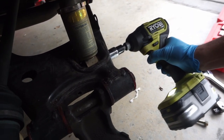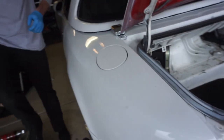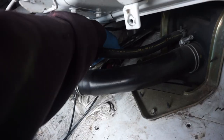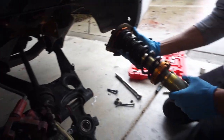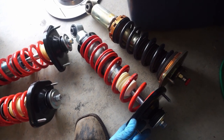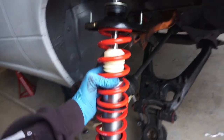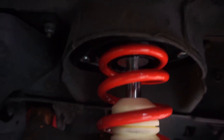Here we're getting some help from the impact gun to remove the coilover — get that bottom bolt out and then we can reach into the trunk to remove the two nuts on the top. It's a bit of a tight squeeze but not the worst thing in the world. Just like that the nuts are out, we can pull the coilover out. You can see Alex is ready to trash this thing entirely — just look at the difference in overall spring length. You also have the helper spring on the new coilover. Everything about this new coilover is a much improved design over the old one.